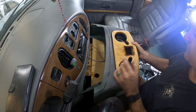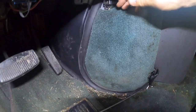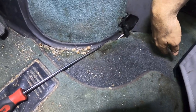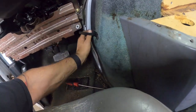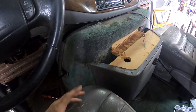To remove the doghouse we have to remove the drink tray first. When you're taking one of these doghouses out, there's a clamp right here - you just undo that clamp. There's a clip right here, you open that clip up, turn it upside down, and it releases that lower latch. The two trim panels on either side have to come out too so the doghouse can clear, and then it just slides right back.